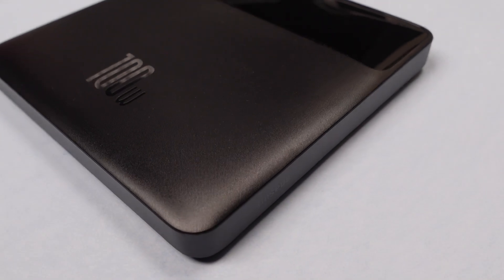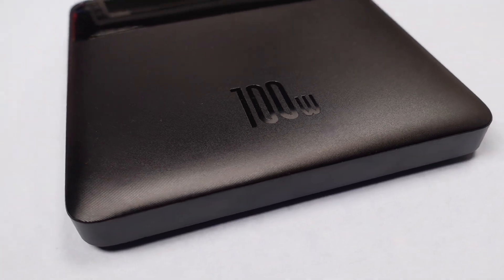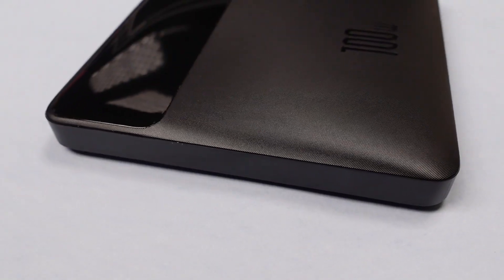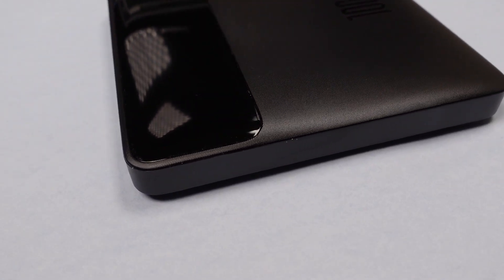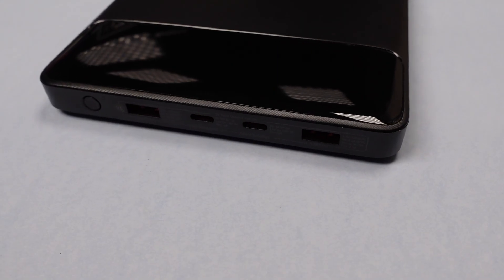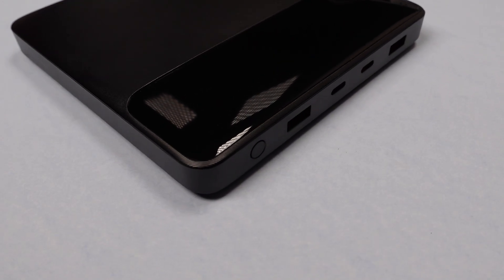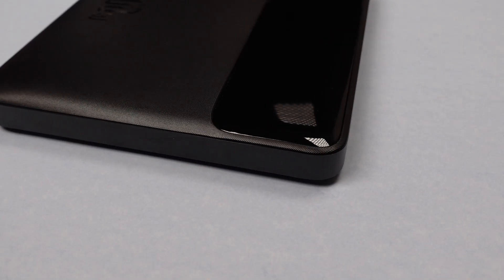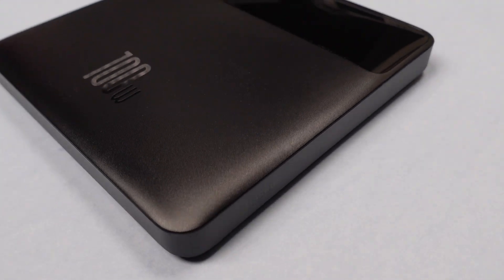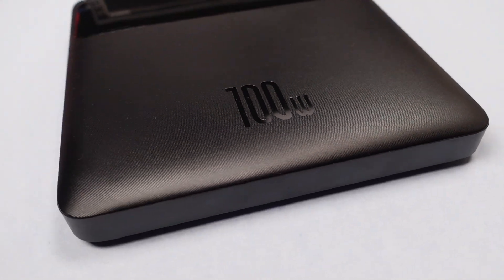Overall, this power bank is actually really efficient, but they had to write on the packaging and marketing materials that it's a 100-watt power bank. If they called this a 60-watt power bank, I'd have to say it's the best one there is. The claim is wrong — this is not a 100-watt power bank. If it had a graceful power down mode, so maybe 100 watts but then it drops down to 80 or 60 to what it can sustain, but no, it just shuts off with no indication of why.